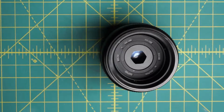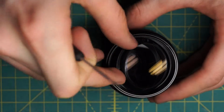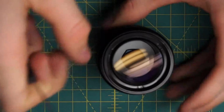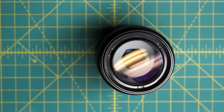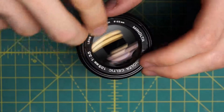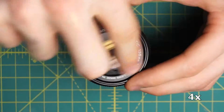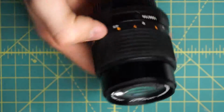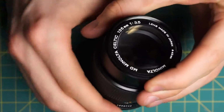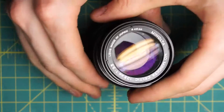Now on the front section here, the only thing I have to do is drop back in the front optical piece. Again, it's not really held in place, which is just awful, but so drop that in place. And then screw in the name ring, which is actually going to hold the front optical piece in place as well, and lock this down with a spanning wrench afterwards. Alright, so that has the reassembly complete. Make sure that the stop down lever, aperture control properly working, and focusing from infinity to the maximum focusing distance as well, or to the minimum focusing distance as well.